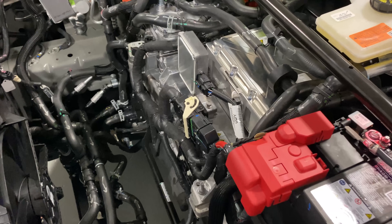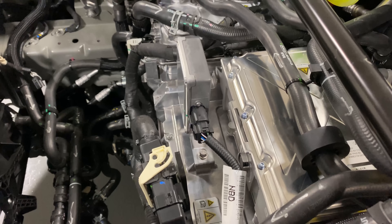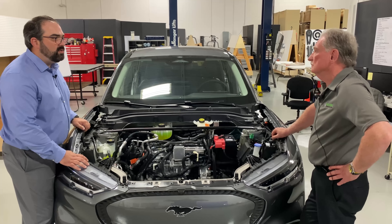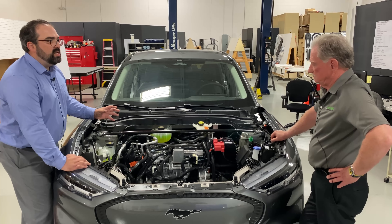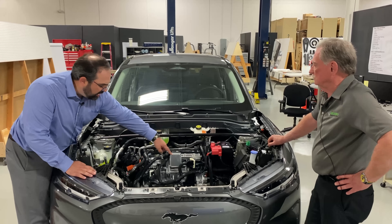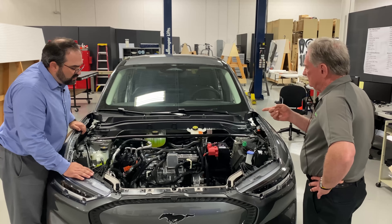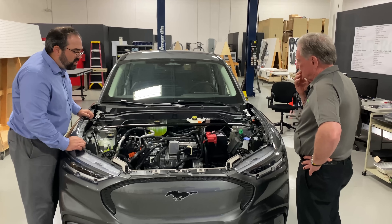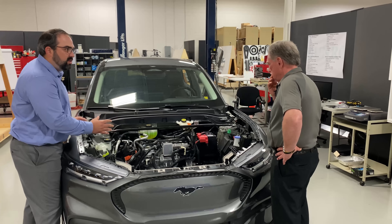Through that charge, they are using some power line communication — some sort of modulation going on at the voltage. It's going to be between 200 and 600 volts, and they'll have less than a percent where the voltage will go up and down. Something in the battery is monitoring that, and there's basically a decoder ring in there gathering that information, which is sent up to this control module. I noticed it's got connectors — is that for CAN bus? It is doing CAN and LIN communication. It's communicating with the entire vehicle, though we haven't figured out everything it's talking to at this point.